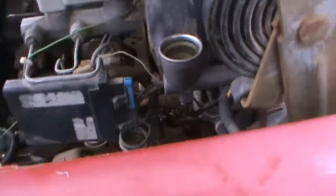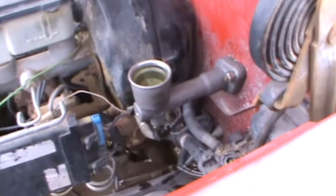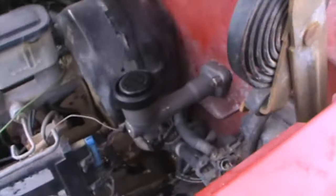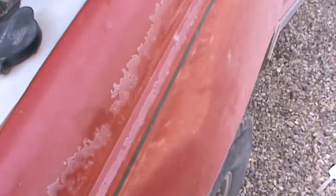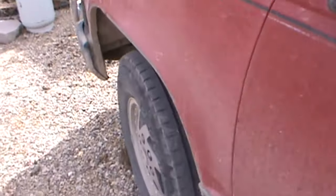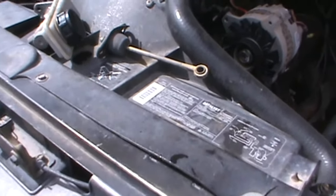All right, guys, after you have adequate pressure and your clutch is releasing, engaging and disengaging again, go ahead and pop your little top back on. Don't worry about excess fluid coming out. It's full, that's all you have to worry about. And there you go. You now have a functioning clutch again. Super simple. If you're not recording, it's faster. All right, guys, that's it for today.